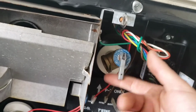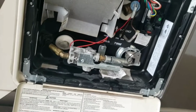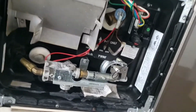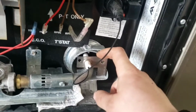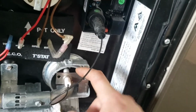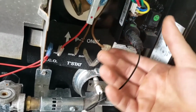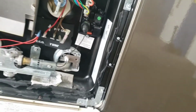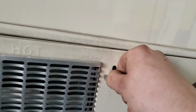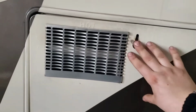If you neglect to drain your pressure first and you try to take this plug out, you're gonna get a bath. And if you've been running it, you're gonna get a hot bath, and that's gonna be no fun at all. And then other than that, clean in here quite often. I would say every quarter, 4 times a year. Just making sure nothing catches on fire. If you get spider webs and they catch on fire and the flame licks up over here and touches this, it trips this thermal fuse and your water heater won't work. Then you just push it closed, pull this little tab out, rotate it, and you can run it closed like that.